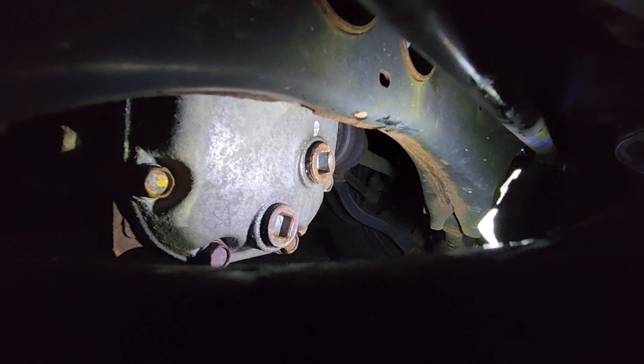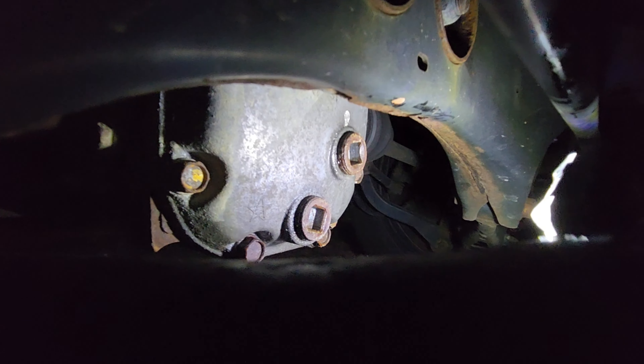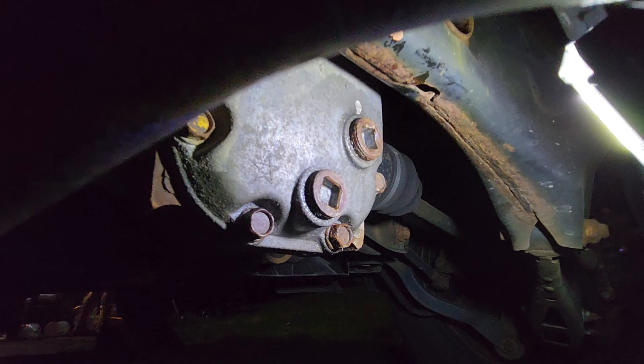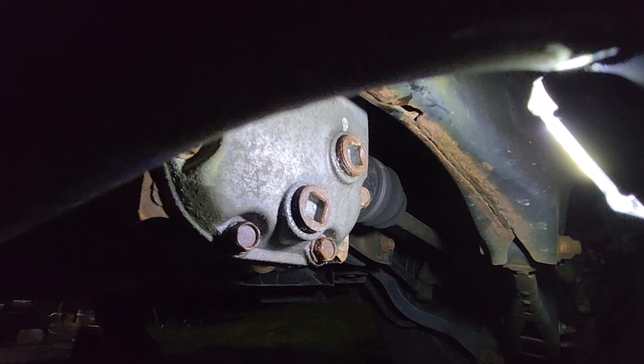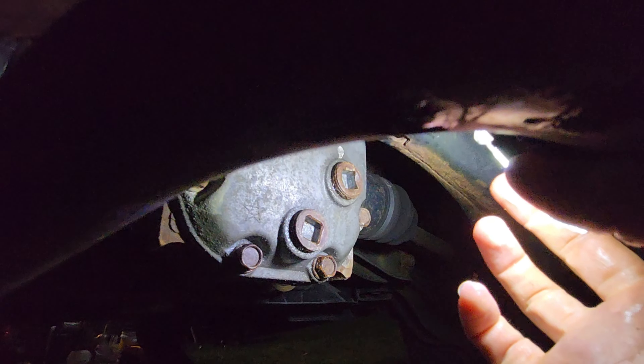This one is good. Used some rubbing alcohol to help break down the leaked overflow fluid, wiped it up pretty good. Another pro tip: I have a dry spot. Now I wonder if it'll be that way in the morning. I'm going to leave an unused paper towel right here — I'll put rocks down so it doesn't blow away. If that paper towel in the morning, 10 to 12 hours later, doesn't have any drops of oil on it, I know this is tight enough, torqued properly, and the O-ring isn't broken. Let's go ahead and be done for the night and come back tomorrow for the front.